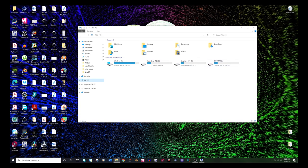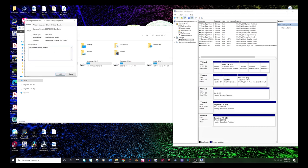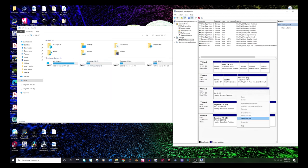However, the drive still does not show up on the PC. It shows up in Disk Management, it's recognized, it tells me it's allocated in drive H — I just can't access any of it. As you can see, the T5 is plugged in and it's nowhere to be found in Explorer. If I open up disk partitions, it's there, but the only thing I can do is delete the volume. Properties says the device is working properly — but obviously it is not. When I try to delete the volume, it's protected.